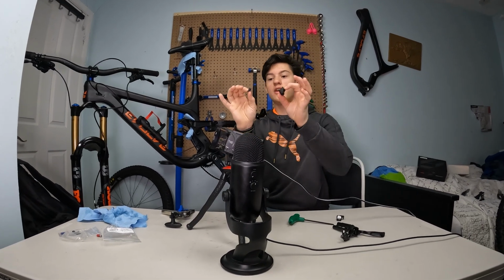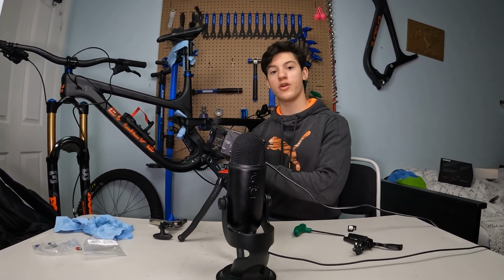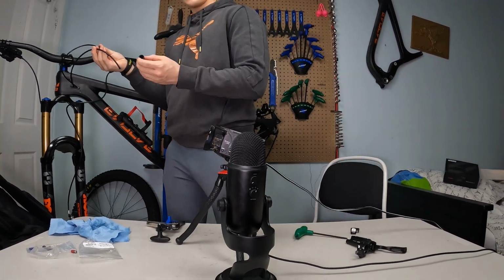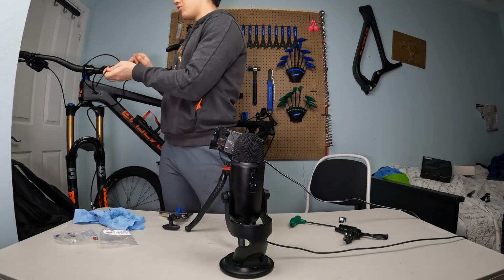Alright, so now you gotta take those two little parts you took from the brake hose when you cut it, and remove that little part with the olive and barb. Those two things you gotta put before putting any olive and barb on there. So you've got that little boot nut and that sort of big screw. Take your cable, put your protective boot nut, put your screw. Here we go. And now we have to put our olive and barb.